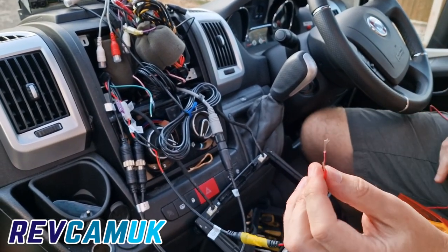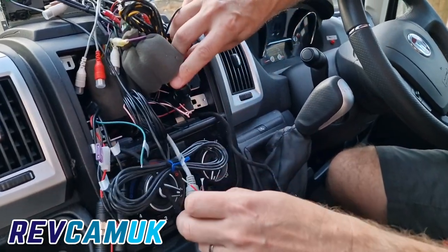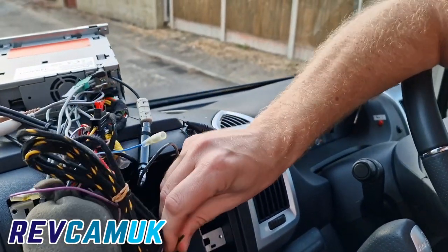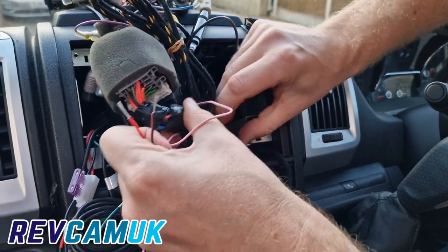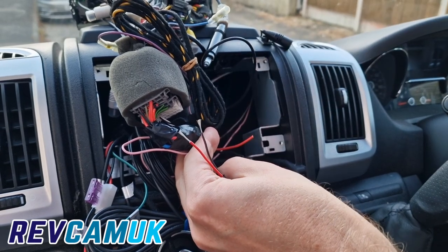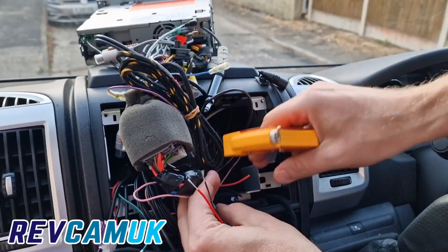Because this version of the mirror monitor has already got a 3-amp fuse built in, I'm just going to cut this down to size because it's a little bit crowded in the back here and I don't want to add more wire than is necessary. I'm going to pre-cut a couple of strips about two inches each of adhesive-lined heat shrink and pop this over the red and black lead just so I can cover the joint at the end. Then next I'll be soldering it onto the red and black lead down here that I've already confirmed comes on and off with the ignition. So I'm going to solder those two together and we should have a nice ignition-based power feed.